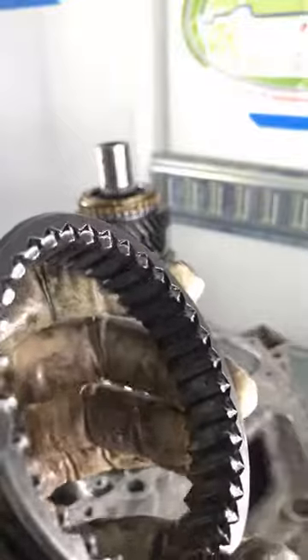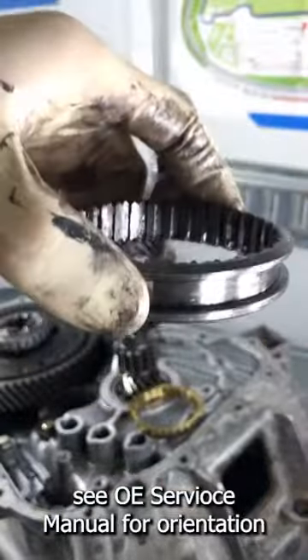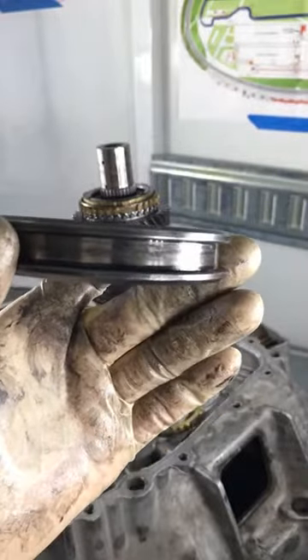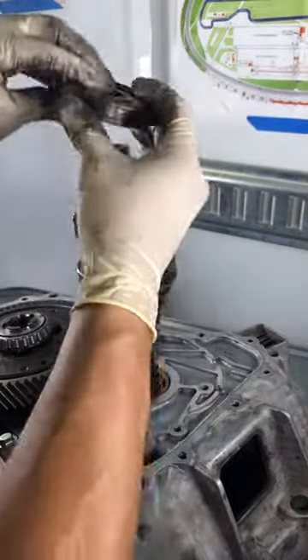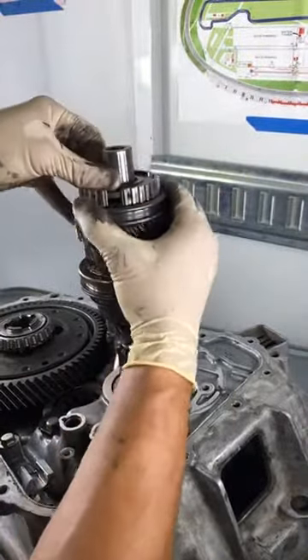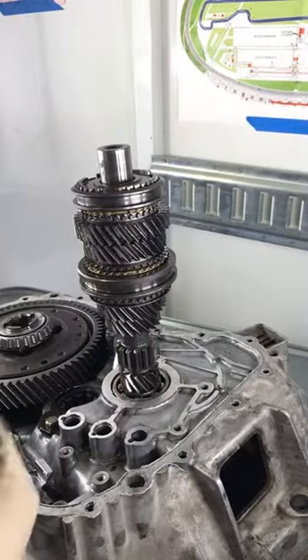Let me see if I can identify them — there they are right there, two right here. You can see they're a little bit taller — they have a little section that's taller. So you've got to make sure you put that in the correct way, and obviously the orientation — whether it goes on this way or the other way — is important. The factory service manual, or the Bible as I call it, actually calls out which way that's supposed to go. There it is — there it goes, and now it'll actually grab fifth gear.